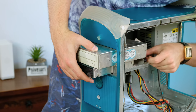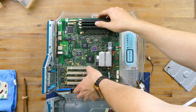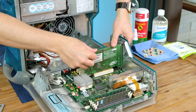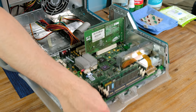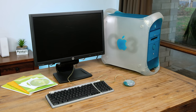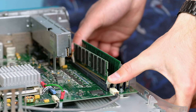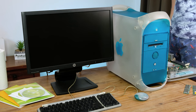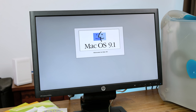Plugging the drive power cables back in with such a cramped space was quite challenging. With the rebuild complete, I tried turning it back on. I was getting the boot chime but no video signal, so it was time to open it back up and hopefully figure out a solution. I hadn't yet touched the 256 megabytes of RAM that was installed. Trying to start up with no RAM yielded no boot chime. Resetting some different PC100 RAM sticks got the system starting up again.